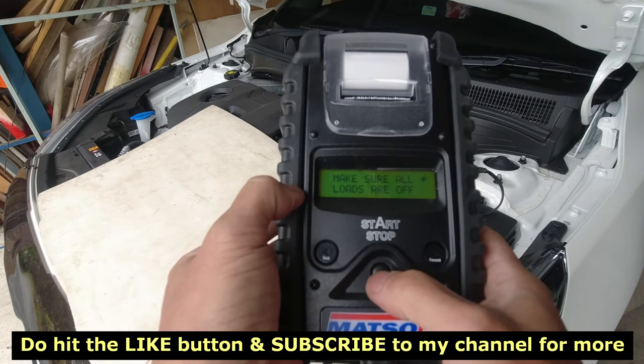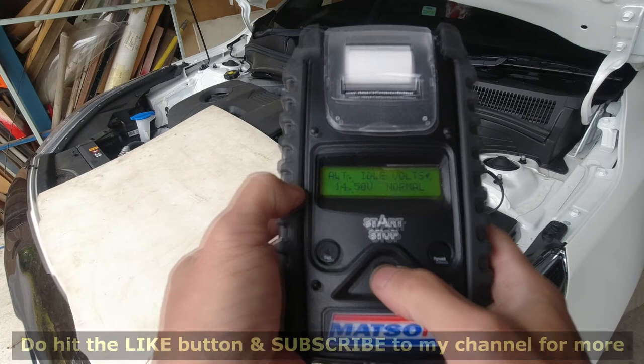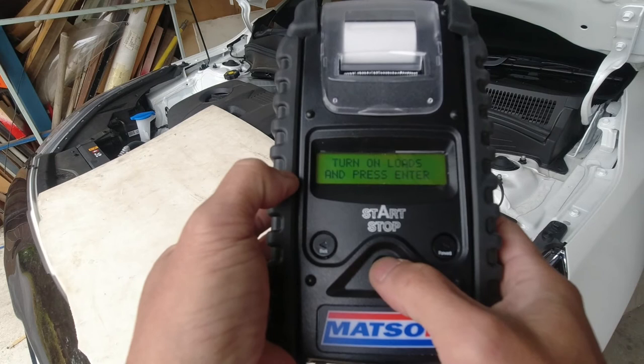Yes, I've got all loads off. There's no aircon, there's no radio, there's no lights. It tells me that alternator idle volts is 14.5 volts and that's normal. So that's good. Now it wants me to turn on the loads and press enter.